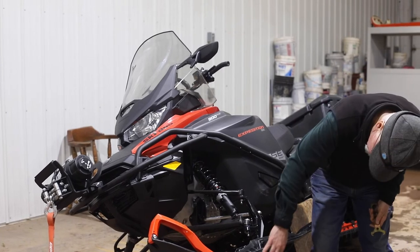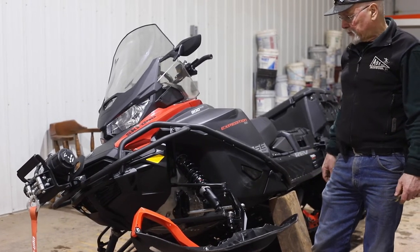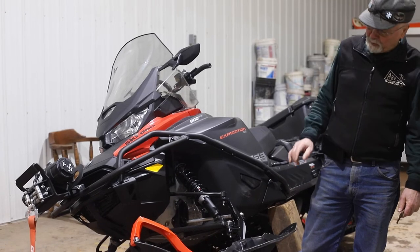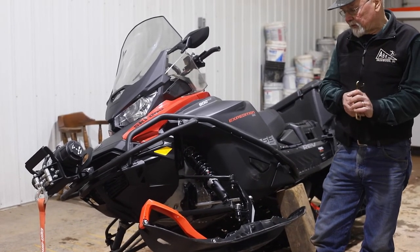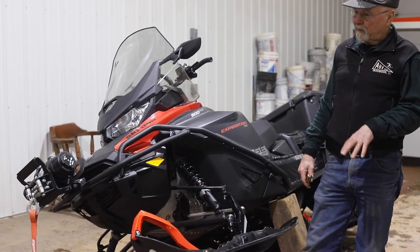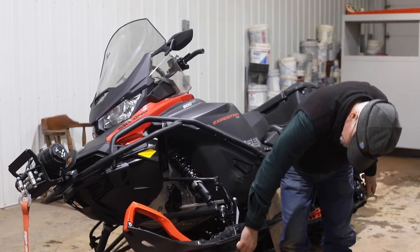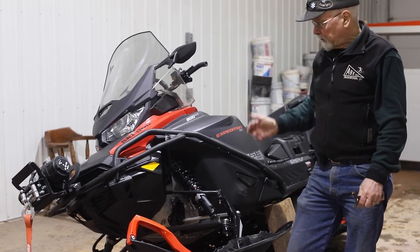This machine still has the stock runners, or wear bars, on the bottom of the skis. They come from Skidoo with carbide on them. The amount of carbide isn't critical on a grooming snowmobile because we're not running on hard ice all the time — we're just worried about steering. However, there is one particular brand of runner that sticks down a little bit further and is built to turn in snow — the manufacturer is Stud Boy and it's called a shaper bar. You can get them in four and a half inch, six inch, or eight inch carbide. Four and a half inches is plenty for grooming, and the shaper bar sticks down about another quarter inch and gives you a rectangular shape on the sides to catch snow — they do benefit steering.